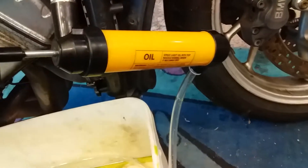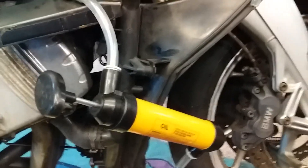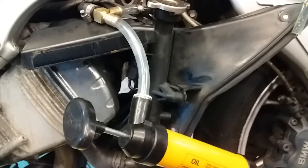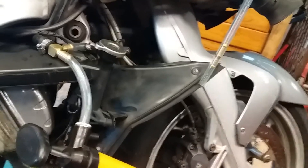The coolant I mixed up is two and a half litres all up, including one litre of anti-freeze concentrate plus about 125 to 200ml of anti-corrosion concentrate. The water I actually got from a pet shop — they have their own filter and it's as pure as you're going to get. I got 20 litres including a brand new 20 litre drum for 17 dollars in Australia, so it's a bargain.